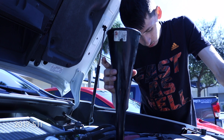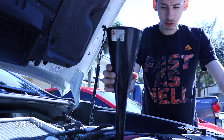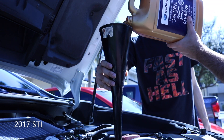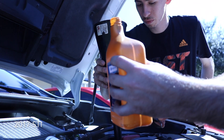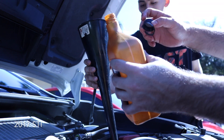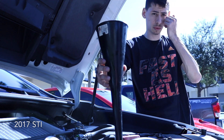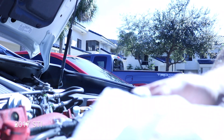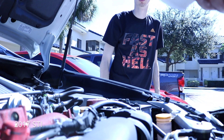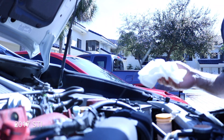We're going to put the oil in now — starting with four quarts, maybe four and a half, then check the dipstick. There was already half a quart in here from a previous oil change so we poured half of this one. We did four and a half quarts total so far. Checking the dipstick it looks like it's right at the second dot, so we're good. I'll run it and check again for leaks.